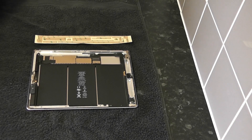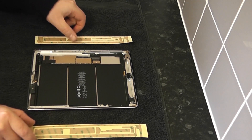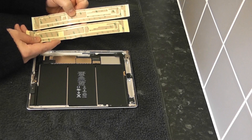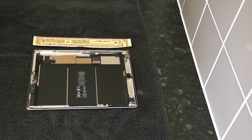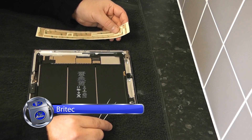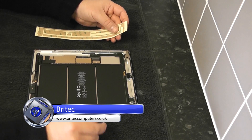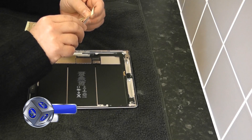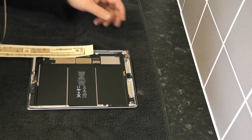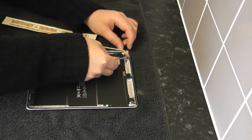Let's get the glue strips in now. There are two types of glue strips here — if you've bought the iPad 3 digitizer, the actual glue strips are going to be slightly different to the iPad 4 glue strips. So you may want to get yourself another set of those. But the actual iPad 3 digitizer will fit on an iPad 4 — they're actually identical. I'm going to use a pair of tweezers to pull these back and stick them around the actual outside of the iPad. You don't want to be putting these actual strips of glue on the black gasket that goes around the outside — you want to slide them on the inside of that. Just take your time — there is a bit of play in these, they're not that tacky, you can lift them back up if you go wrong.